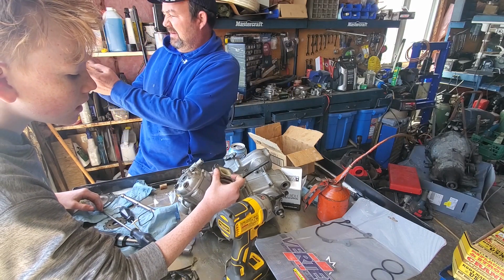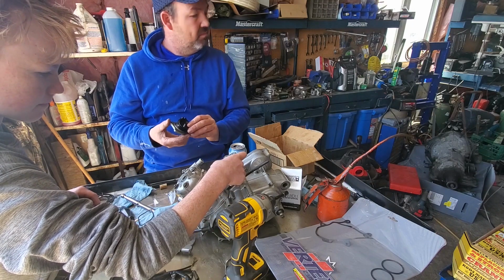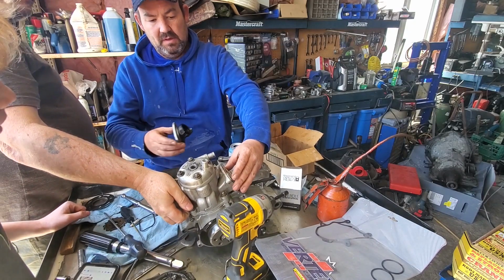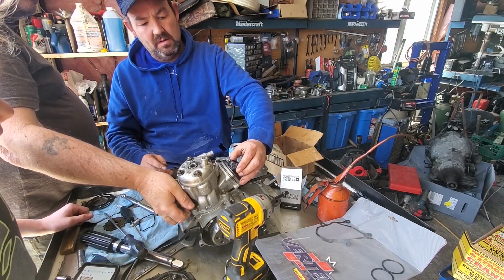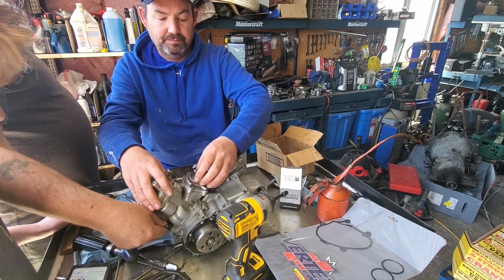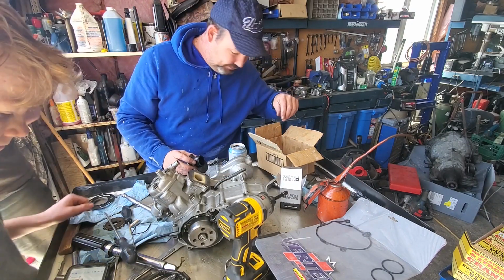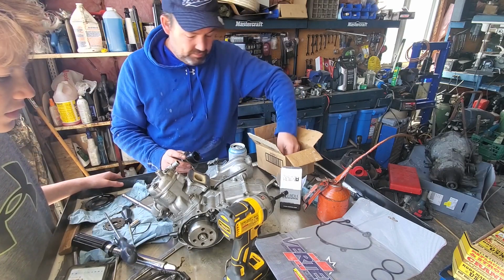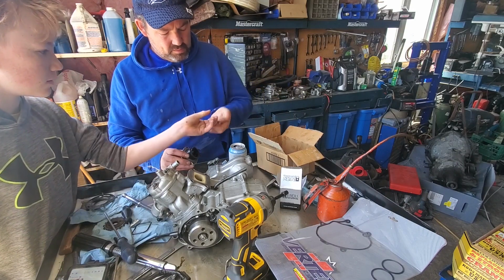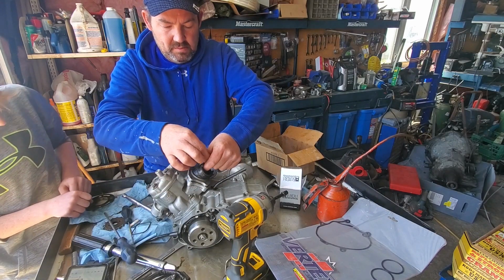Chris, the up way, was that angled up? That's what I'm trying to remember. You gotta take the way the engine sits. The engine sits basically like that in there, right? Yeah, so it's like that. So your carb is level, and the air filter is up. Typically those are marking your top because that's how you center your carburetor for level. And those would be these little washers. Yeah, it has to be like that. We'll go like that. Jam it in.